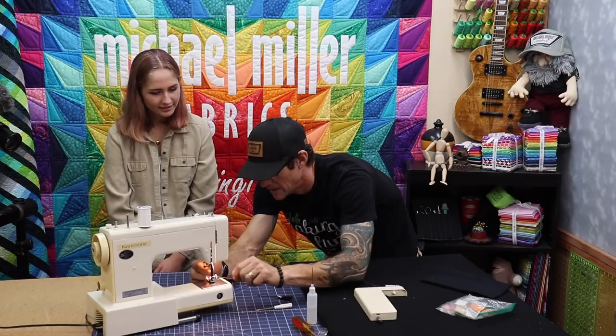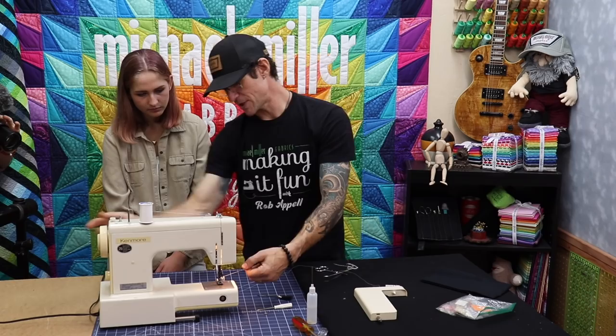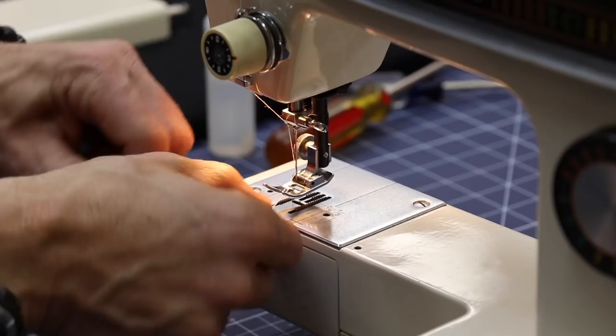I'm going to just be bossy and reach in here. I'm going to hold my needle thread. I'm going to take one complete stitch. Quack, quack goes this machine. I'm going to hopefully watch that bobbin thread come through that bobbin door. Now it's up top. This is going very well so far. Okay, so now I'm going to put both of those threads underneath the presser foot.